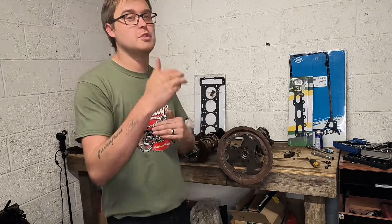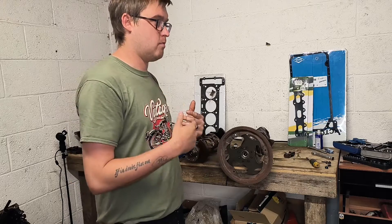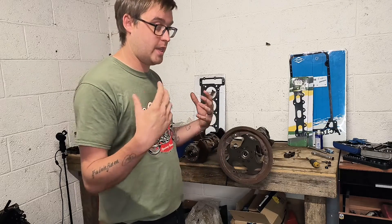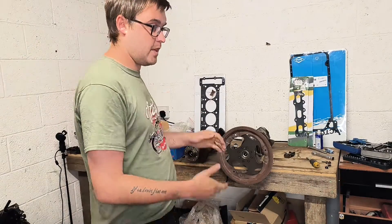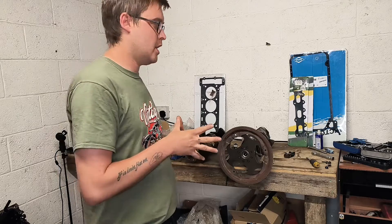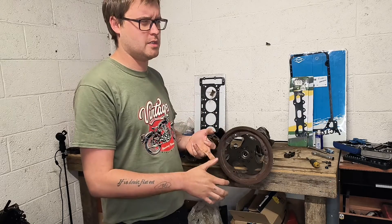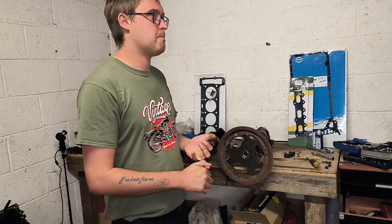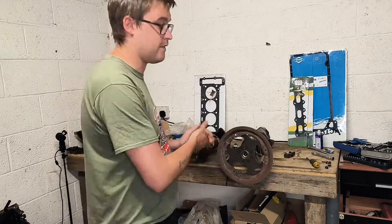The engine with valve springs and retainers could rev to 7,000, however once you're up in that rev range you'll start to run into other issues like head flow — you'll be restricted by your cam profile, port size, and how everything is set up, especially in the pre-evo head. The post-facelift evo head is a better design and far more beneficial. I think they've got sodium-filled valves, a lightened crank, and a strengthened block, so for revving out you're better with an evo M111.